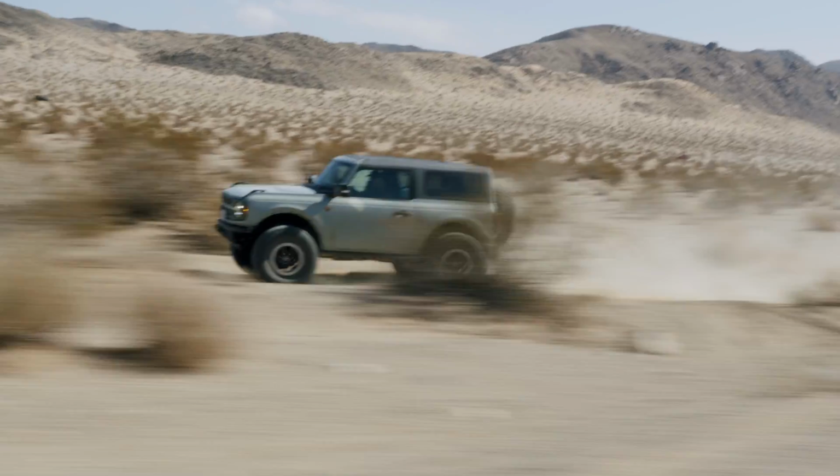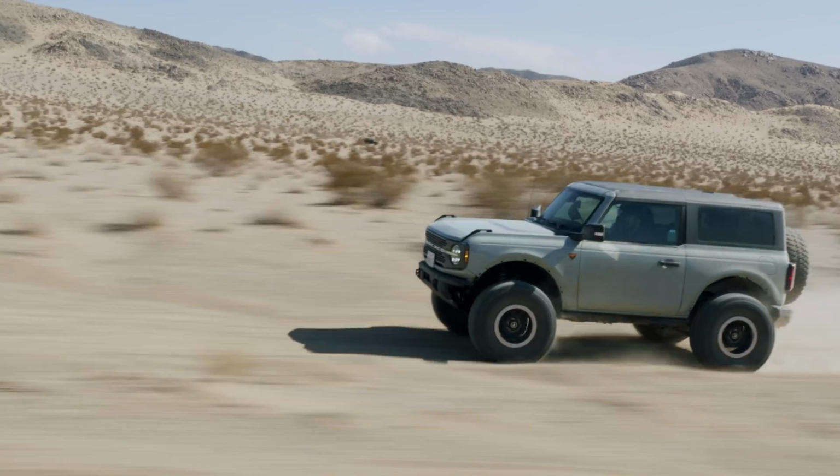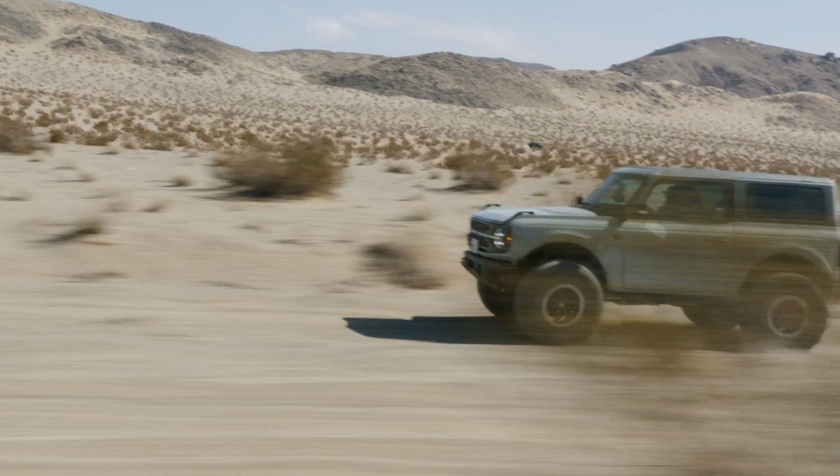We'll be honest, these offered way better small bump sensitivity and were way more comfortable at lower speeds than the Bilstein 5100s and especially the stock ESCVs. And honestly, they really rivaled some of the big bump support even at higher speeds of a lot of the 2.5s we tested so far. They feel almost progressive in nature, which keeps the Bronco really high up and on top of the bumps. And we think with a smaller tire will allow you to just skip right through the rough stuff.